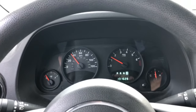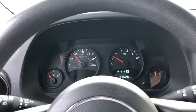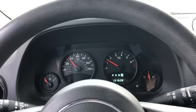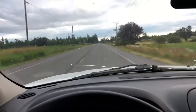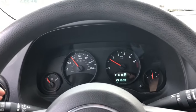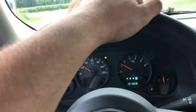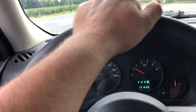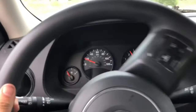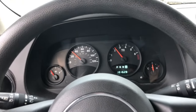At the beginning of the video, I'm sure I threw in a sound of it whining and making lots of noise. But I think we got lucky with this one, boys and girls. She's running like a boss, making no noise whatsoever, shifting fine. Pretty stoked about that. So now you know, okay? Save you guys a bunch of money. The CVT fluid is not cheap, but it looks like one can is going to do you. So that's all you need. Pay attention to how to do it, get yourself a dipstick, and you're good to go.